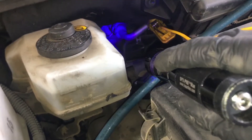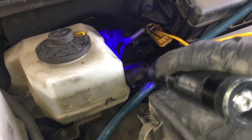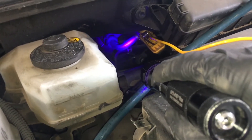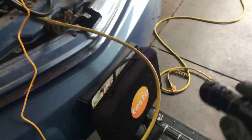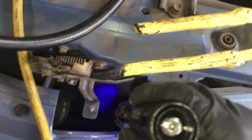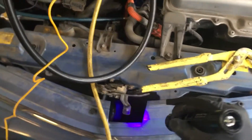It appears unless I find a trace of a leak coming from under the dash, I will be recommending these two o-rings that used to be a problem years ago — this one's just showing up now. The o-rings on the liquid line will be replaced and the ones on the suction line will be replaced. Since I know this car goes off-road and hits a lot of dirt and debris, that dust buildup could have been from when it was wetter and it went through dust and mud and it built up there. So I do not want to falsely diagnose. I've been trying to stick my leak detector down there looking for leaks, and I cannot pick up a leak down there.